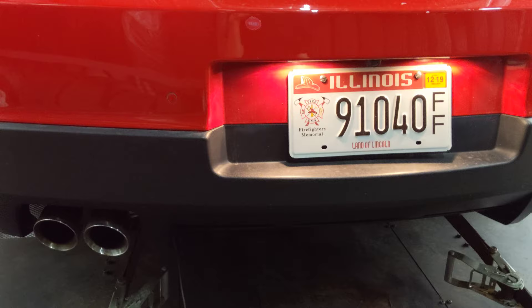Stage one cam's got a nice little idle. I got the idle set at 750 RPM, so not much over stock, but this cam will idle down that low. It has real nice low and real good drivability off idle with this cam. This is our smaller cam — we have a real broad power band in this cam.